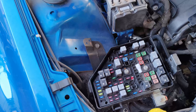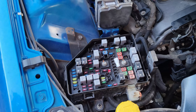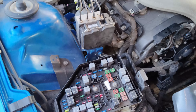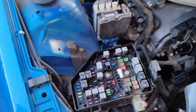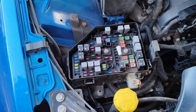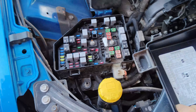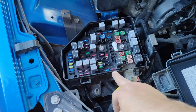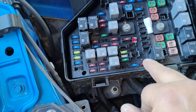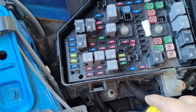Not knowing the car — stupid is what stupid does, eh? I was just looking around the front, seeing if there was an earth point. I haven't done any wiring on the back yet, we'd just gotten to the point where I was about to. But I had to get going so I put the lights back in temporarily. Just while I was waiting, I thought I'd have a quick look to see if there's any earthing points. The cover was loose, so I went over the cover and found that these two front fuses are supposed to be both 10 amp, but the spare only had a 15 amp — no 10 amp spare. So I swapped the 10 amp from that side to this side there. Taillight works.